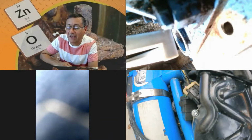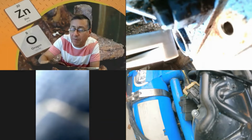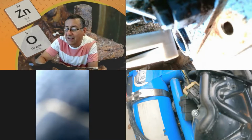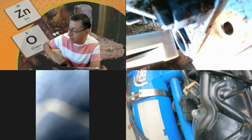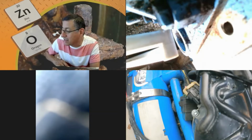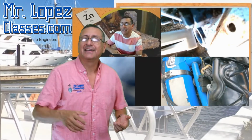You see on top of the distributor that starting in each cable you have the path of the circuit, and it's located in that position, and the other one in the other. You see? Now we are going to understand that the first one will be number 1, and the second one clockwise should be number 8, and the third one will be number 4. If you follow those paths.